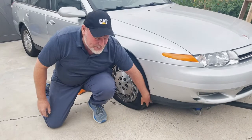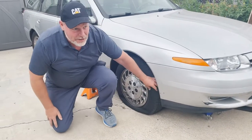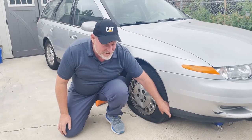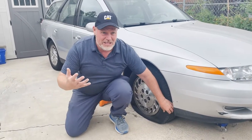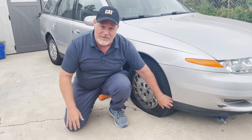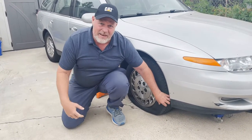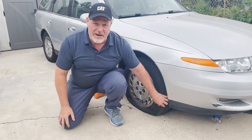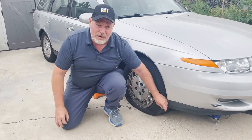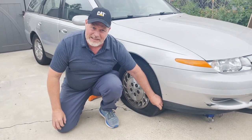We're not going to do a patch plug, because technically by law you cannot fix a tire that has a hole within an inch of the sidewall. But let's just say that you're stuck somewhere and you need to fix your tire. That's what this video is going to be about. Put a plug in it, fill it with air, get to where you need to go. But really, the right choice if you have a hole within the sidewall is to replace the tire, not to put a plug in it.